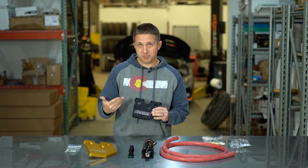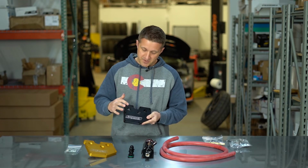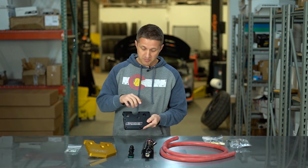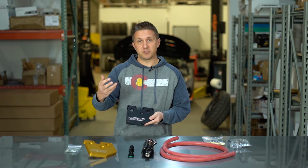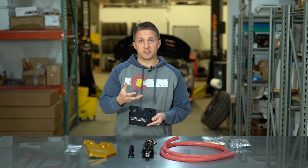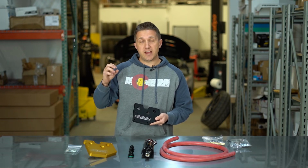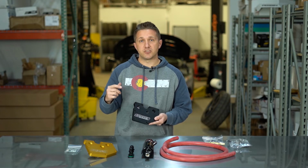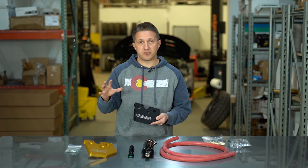So you can set this up a variety of ways. Well, actually, let me back up. The factory way of setting it up is a port that goes from this plate to the intake manifold. The intake manifold under vacuum sucks all the crankcase pressure out when it's at idle. The vacuum sucks it out, and then when you're at wide open throttle and there's a lot of pressure being generated there, it actually goes through the valve cover and back into the intake pre-turbo. That's the factory version.